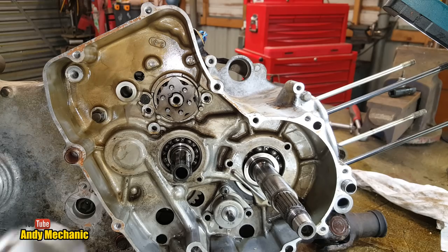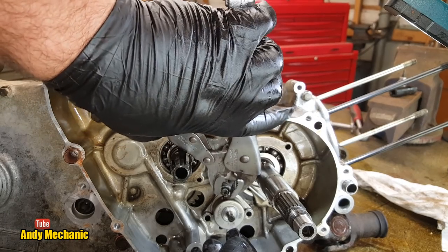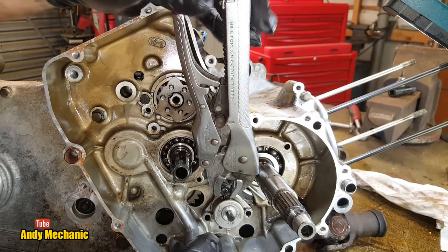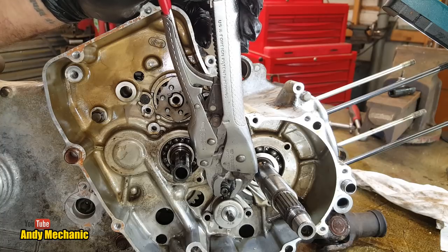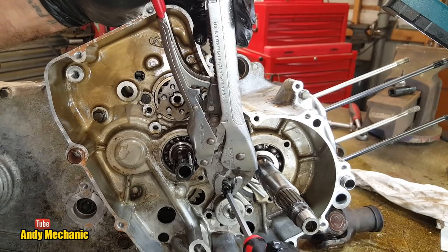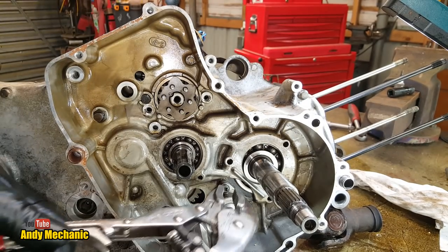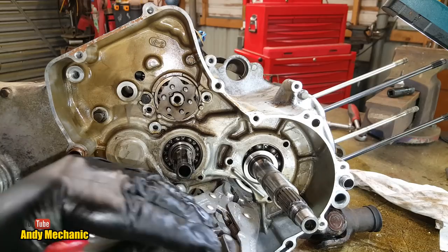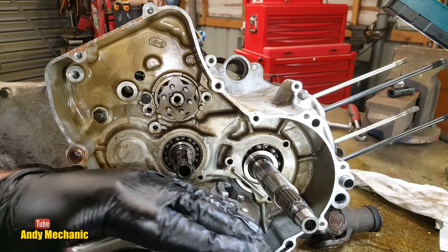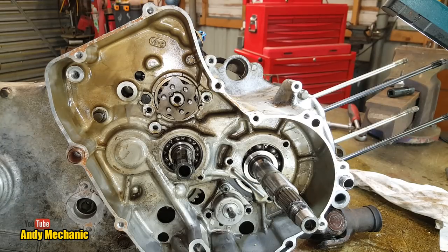Let's try these. Now, if you do chew up a bolt like this, because we're inevitably going to chew it up, then you should replace it. Don't put it back in chewed up. And if you try and turn it with the screwdriver at the same time, that actually helps. Yeah, that one is a tight one. I might have to get a bit more movement. These are pretty cool mole grips because they sort of self-tighten, but they can also be a bit of a pain sometimes as well. Okay, I'll get a punch.